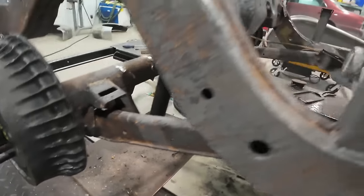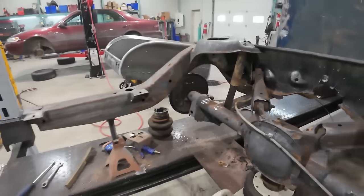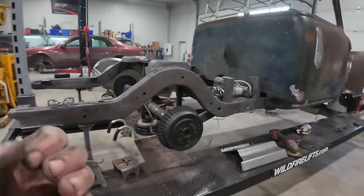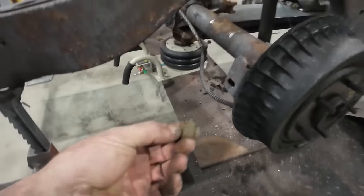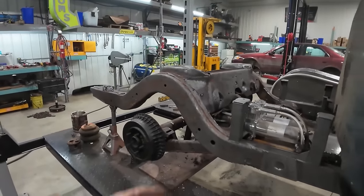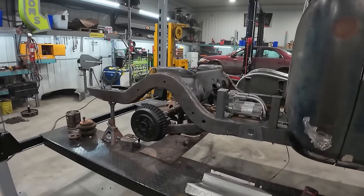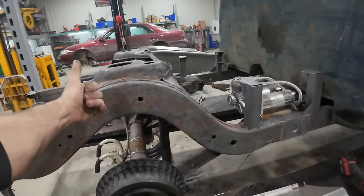Like, wow, it did not do well on the diff and stuff, but that's okay. Now I know. So basically the needle scaler is the first thing to use on something heavy. If it's flash rust, or if it was this steel plate where you don't have heavy flaky rust, it's fine, but stuff like this it can't do anything with, because you can't knock that off. Anyways, I know I've blabbed about that a lot, but if a fellow was paying somebody to do this and nobody was prepping the frame right, you'd be pretty disappointed in that job. If you're driving down the road with your freshly painted thing and all this stuff starts flaking off like that, that would suck a lot.